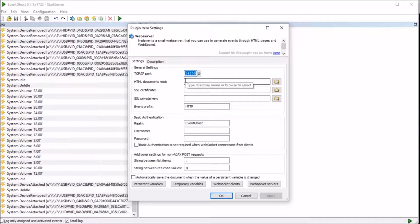So when you open up this screen, it should be the same number that I'm showing you on the screen. But it can really be any available TCP port in your router. So it can be something else that's already open or something that you're comfortable opening. Now if you're not familiar with ports at all and you don't know anything about port forwarding, you can go ahead and go to portforward.com, and they should have detailed instructions for your router model, and you should be able to use that to pick a port and open it up and get that going.